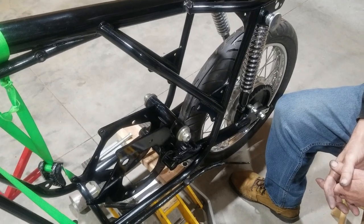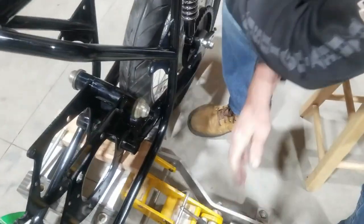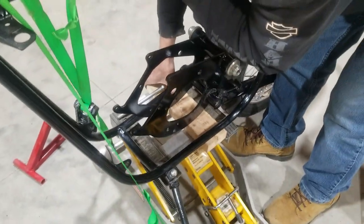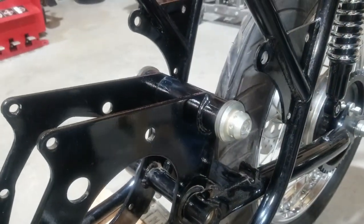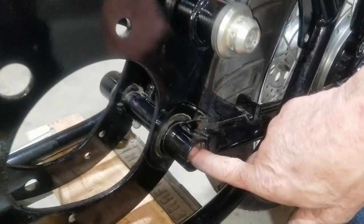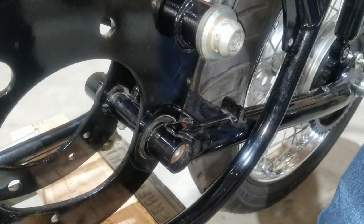And we're going to be working on the Mark III, 1975 Norton Mark III. We've taken some stuff apart so far here, and we're getting ready to work on the cradle here. We took the Z plates off, and we're going to put the boots on, get this adjusted, get the boots on, and put the axle that goes through there. I want the Z plates reinstalled, and that's kind of what the plan was. Yeah, and then we also got to put the welch plugs in the felt, and this is filled with heavy grease. It's supposed to have 140 grease.